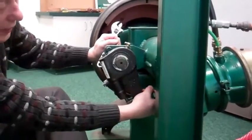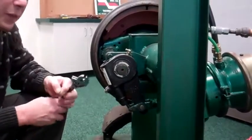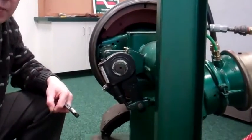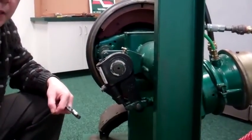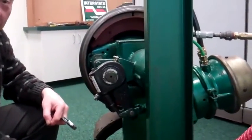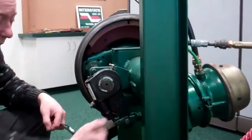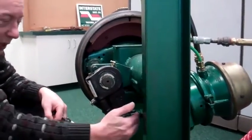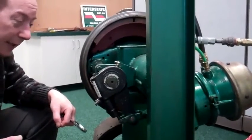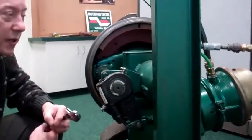It can be a little over an inch, because when I go inside the cab, I can do an in-cab adjustment by pushing the brake pedal fully three times — pushing all the brake chamber rods as far as they possibly can. They're designed to automatically adjust when they come back. Correct.